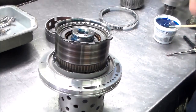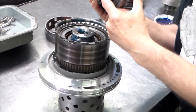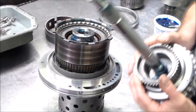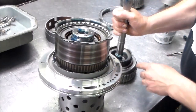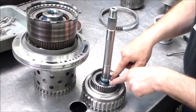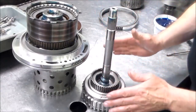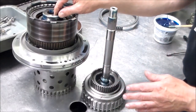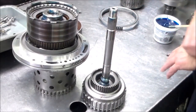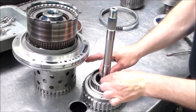Okay, now the forward drum. I also have new solid white rings here. I put one ring on at a time. I spin the ring on, like with the scribe, and then I use the stator. Try to center it, grease it, and use the stator. It's got a big enough chamfer that it'll resize the ring, and it should go in without a problem. Just try to squish it as best you can back to size.